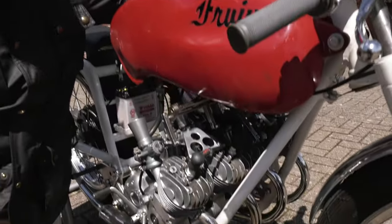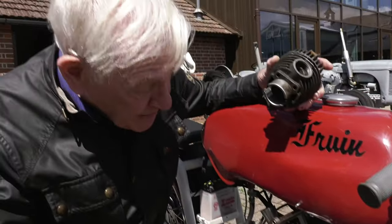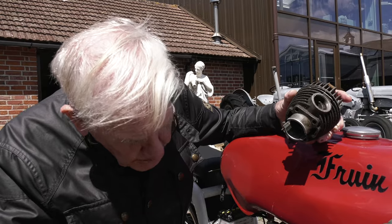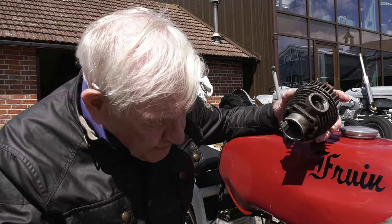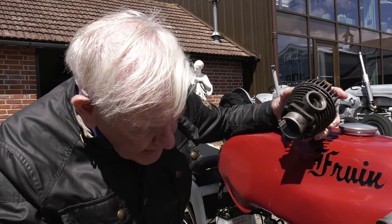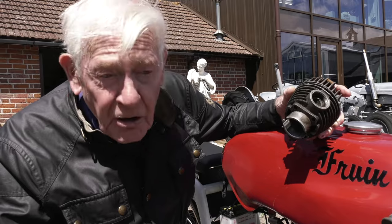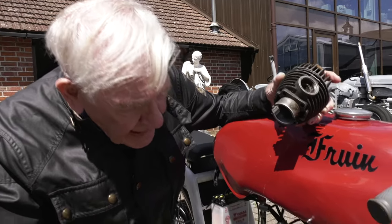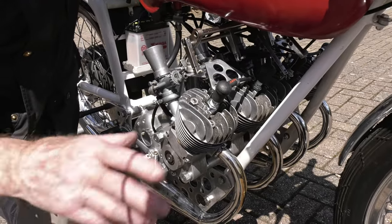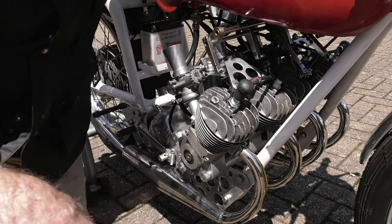We're going to fire it up again and John Ring's trying to get the carburation sorted out. We've just discovered it's weak low down, so after we give it a run he's going to up the pilot jets and see how that affects things — maybe richening it up on the needles. Unfortunately he doesn't have any main jets, but it's on a 90 main jet at present which should be more than enough. We've got to give it a crack and see what happens.